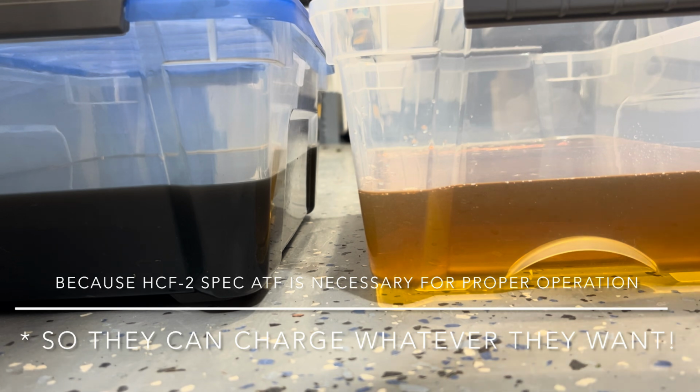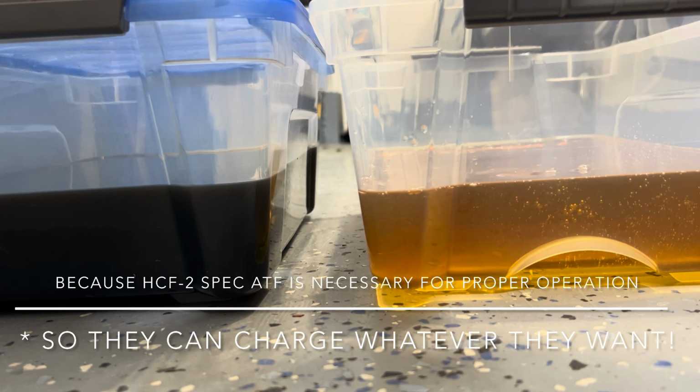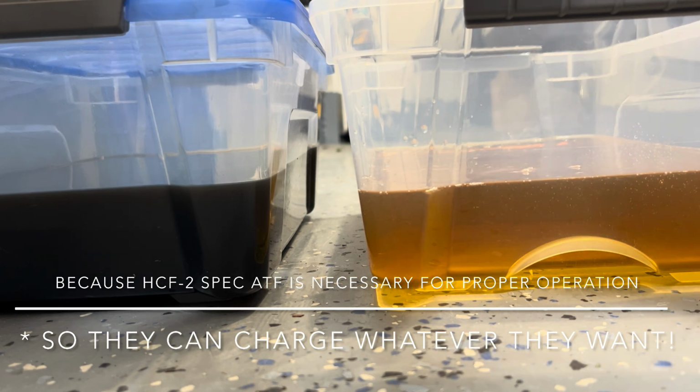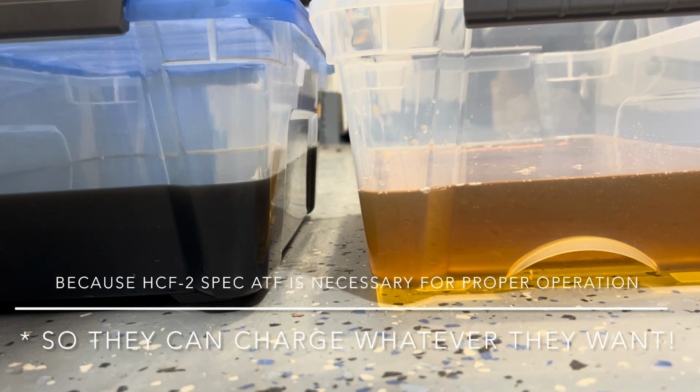Okay, so I'd rather change my CVT oil early because even though I don't drive the car hard, the CR-V is a heavy car with a small turbo engine, and generates quite a bit of heat, and the transmission fluid gets probably worn pretty fast, right?